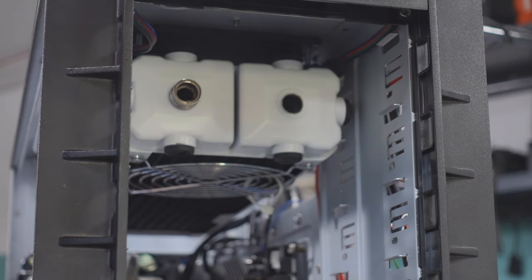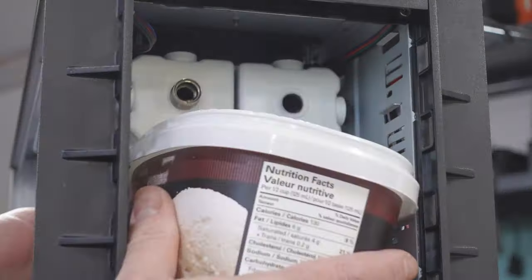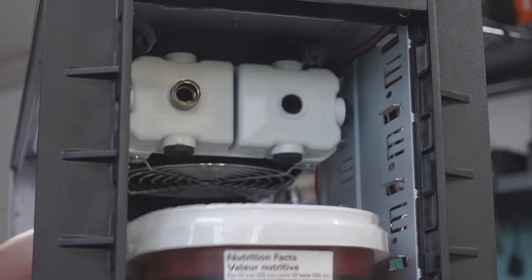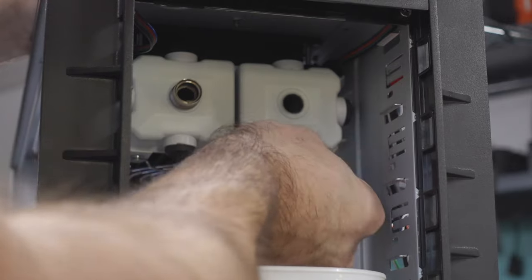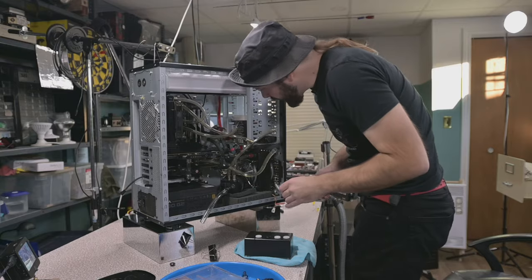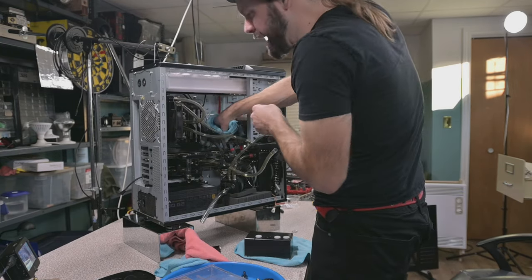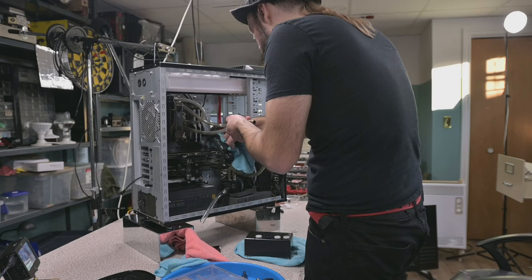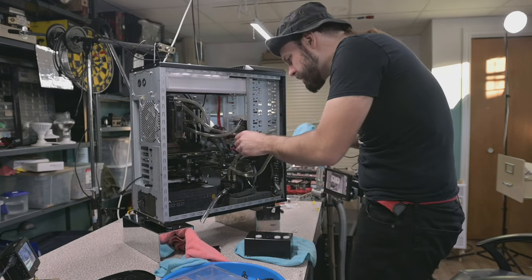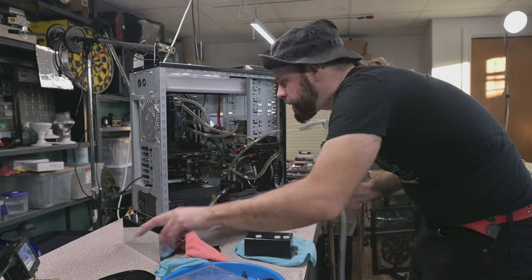Now, I'm going to be using the bottom outlets on this guy. You're gonna notice the specialty tool is designed to fit into a 5 1/4 bay for the drainage purposes. Let's loosen this plug, see what happens. Definitely, there's gotta be some water there, right? Yeah, look at it. And I managed to splash only a little bit of it inside the system. Keep many rags around. Don't worry, this is sometimes a normal part of the process. As long as you make sure you don't get it anywhere questionable, just make sure you dry it up before you turn it back on.